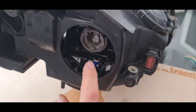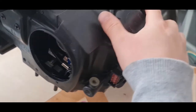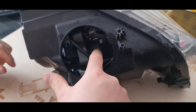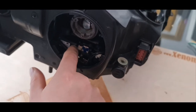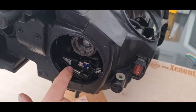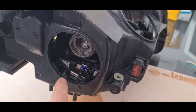So if you don't have a full beam, it means that either your electronic circuit, which is located inside this black plate, is faulty, or the full beam actuator — which is this black box — is faulty. Either this black box actuator is faulty or your electronic plate inside your headlight is faulty. Actually, this electronic plate is hanging in the air — it's not at the bottom of the headlight. If this part gets faulty, it means that you have a severe moisture water ingress issue in your headlight, and in any case you have to repair your headlight.